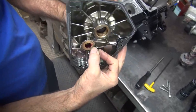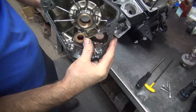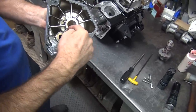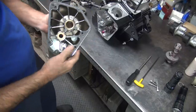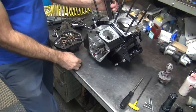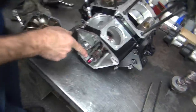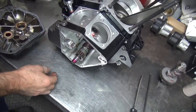Right, which would not be a pry mark because you're going the other way. Yeah. So it's definitely off. It's hard to. I'm prying right up against this bushing, that shear is what I'm pulling off with. So there's your mark on the shaft. So it's definitely on the outer edge of the bushing like we thought it was. Mm-hmm. Not on the inner edge.